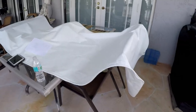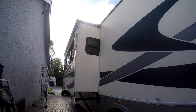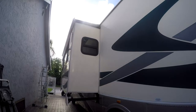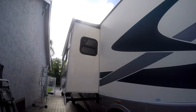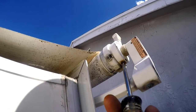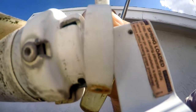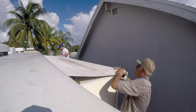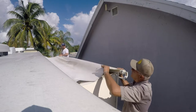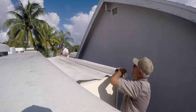Start on this side, with the slide-out open all the way. Position your ladders carefully. Remove the anti-bellowing device to clear the slot at the end of the roller tube. Then, with two people, unroll the old fabric carefully. Keep in mind the roller tube is spring-loaded.